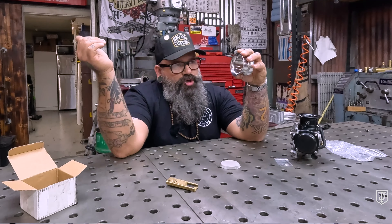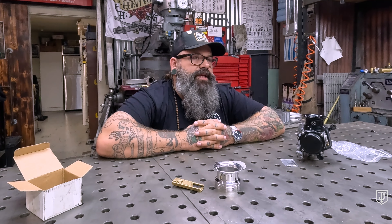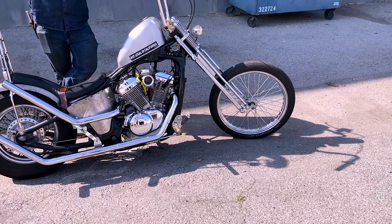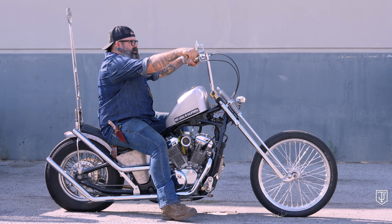In short, a velocity stack is a wonderful choice for your motorcycle. Even if you live on a dusty road, not a lot of dust is going to be an issue. The only time I've ever seen a problem was in pouring rain being blown sideways into the side of my bike — I had a little bit of sputtering but the bike didn't die or stall. If you're riding in normal conditions — dirt roads, street, all kinds of weather — a velocity stack is going to have no problem at all. It will lean the mixture out on your motorcycle, so make sure you tune properly.